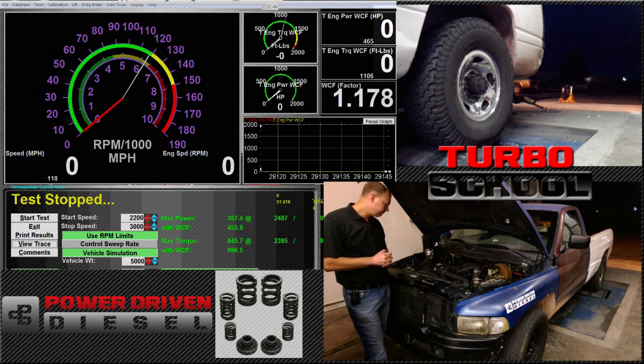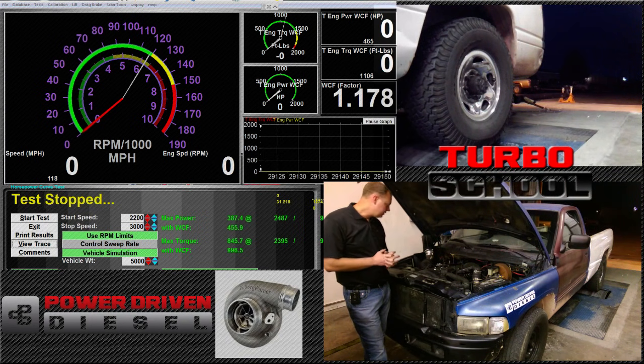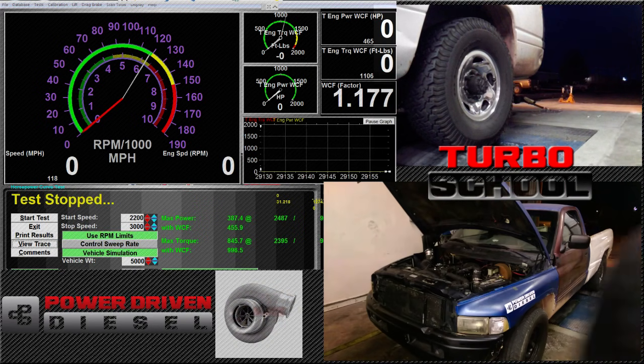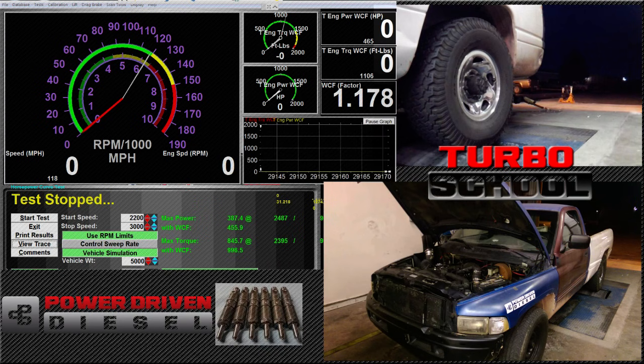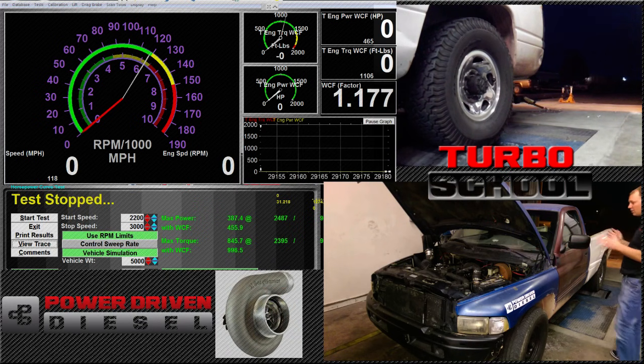What we're going to do is use my turbo tuner to get it right at 35 PSI — that's what we had in our notes. 35.7 PSI is a 4.0 pressure ratio in the area I live, which is around 5,800 feet elevation.